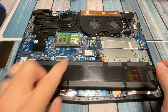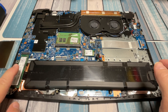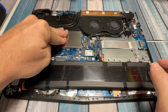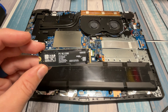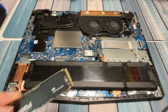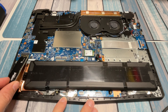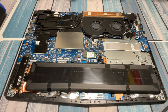For this particular laptop, I was hoping to add a one-terabyte hard drive in that empty bay, because it's already got a 250 gig SSD running Windows, but it looks like I'm just going to have to upgrade this NVMe instead. I've got a Crucial P3 one-terabyte SSD — this is an NVMe drive, not a SATA drive, so make sure you get the right kind. Just look at the offset notch, pop it in, wiggle it until it's fully seated, and then replace that set screw.